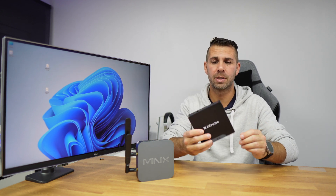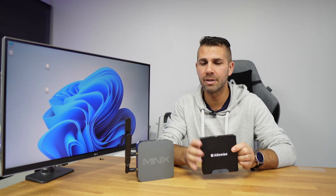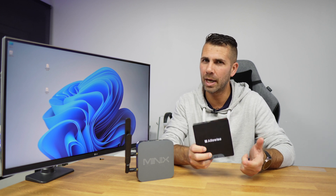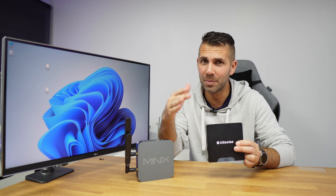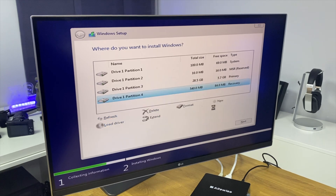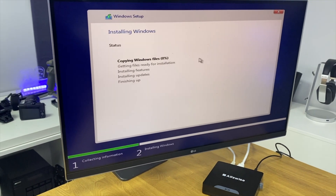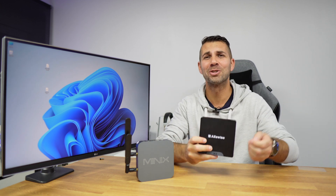Now about Tiny 10: the oldest machine here has 2 gigabytes of RAM and 32 gigabytes of storage. When I was installing Tiny 11, it did not recognize the disk, which is an eMMC. The solution would be to load drivers during installation, but I was not able to find those drivers. If you're stuck at the step where it doesn't find internal storage, try Tiny 10 — it recognized the eMMC and the installation completed successfully.